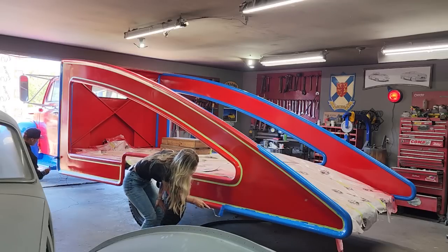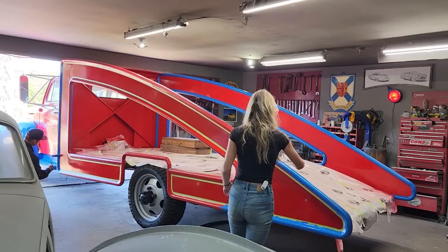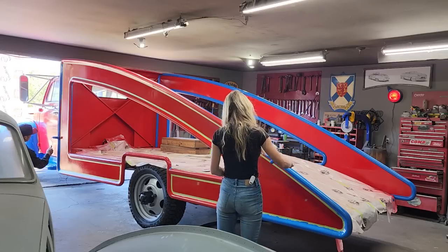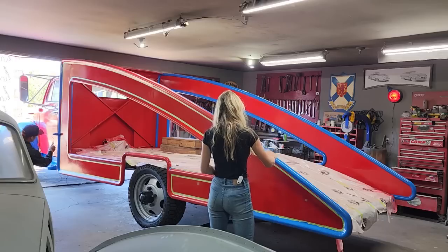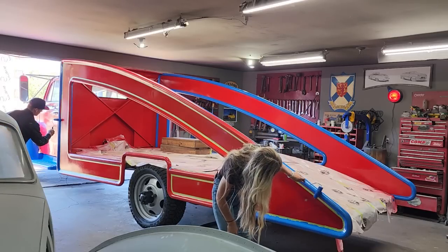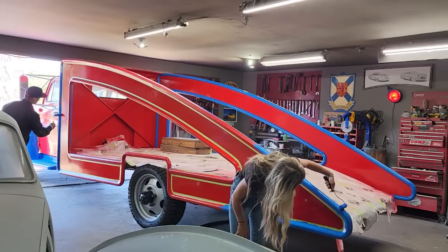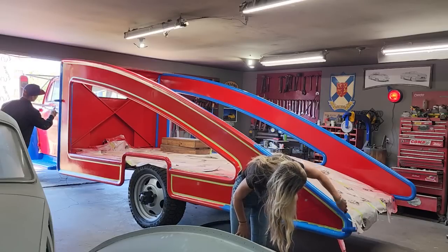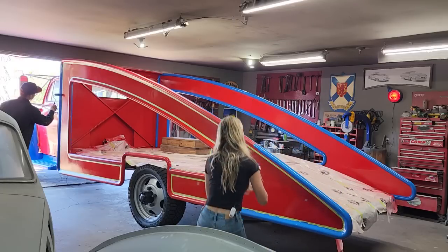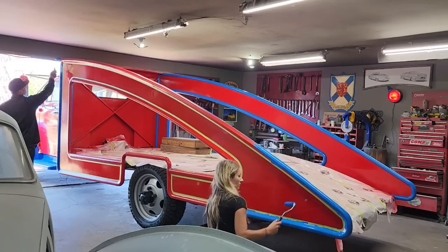It's nice too with the roller, like I said yesterday, with the body fill and the fiberglass that was not primed, not dealt with, not sanded the scratches out or anything. We obviously know there were scratches in it. I finished it off with an 80 grit, so you must realize that there were scratches in the body fill and in the fiberglass. And with this paint rolling it on, kind of give it a nice texture to cover it and to deal with it.